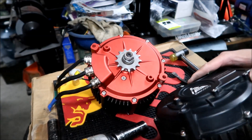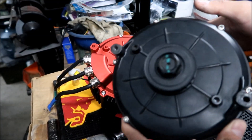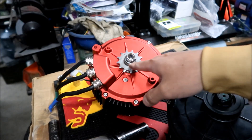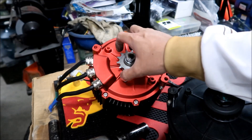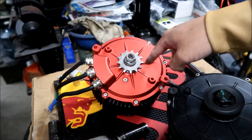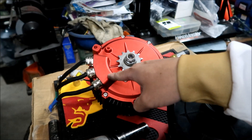These other motors don't have anything sticking out on this side — nothing. So if the chain comes off, it's not really gonna break anything. However, if your primary drive chain breaks, hopefully it ejects through the backside, but it could potentially wrap around this and destroy it.